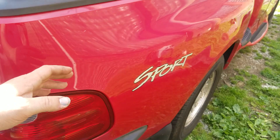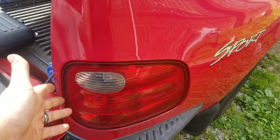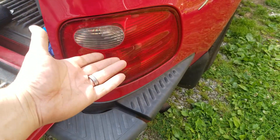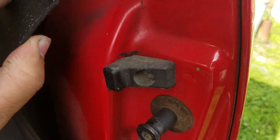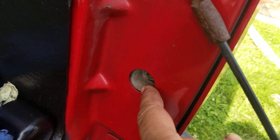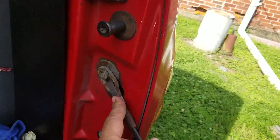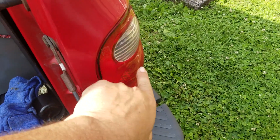A lot of these have the flare-side step beds on them, and they have absolutely no screws on the outside to access. A lot of people crawl underneath the vehicle to try to figure out where it's at, or they come inside here and try to pull open the cover. It's because right here you've got two different bolts — one here and one right behind your tailgate cable — that will access this particular taillight cover.